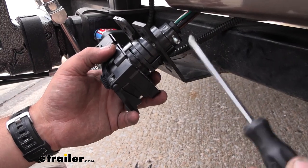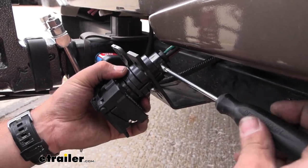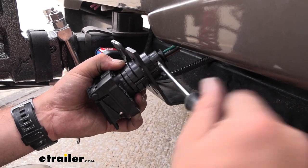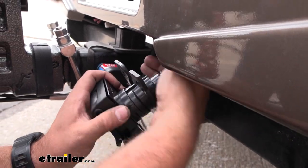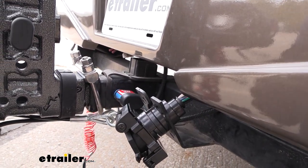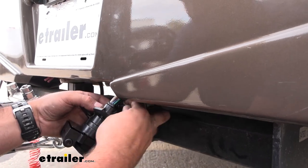At this point we've got our dielectric grease in there and this is able to close up. I'm going to go ahead and tighten this down, and that way it's going to seal up that entrance where our wires pass through. I'm also going to take a roll of electrical tape and just wrap this up so that it's a nice watertight seal long-term. This is up to you, but you might as well do it just for that added protection.